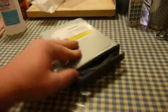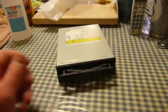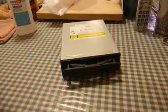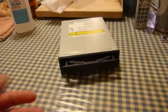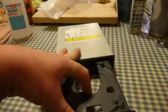Anyway, the main point of this video — I don't think there's going to be anything seriously wrong with this — the main point is to discuss how to actually get one of these drives apart non-violently, in case you ever have to do this on your own. One of the first things you want to do when taking one of these apart is open the tray. Before you shut your computer down, just eject the tray if it will come out.